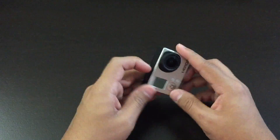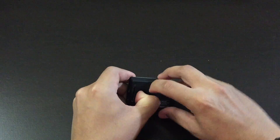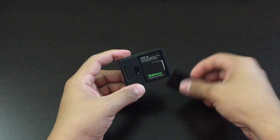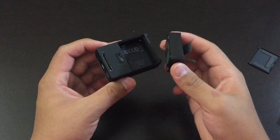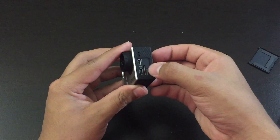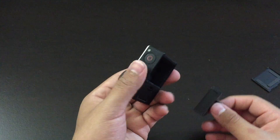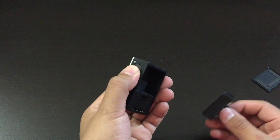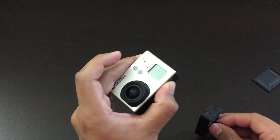The next thing you want to do is go on the back, remove the battery lid, take out the battery. After you remove the battery, then you want to remove the SD card that you have inside. From here you want to hold the capture button for five seconds, insert the battery, and then you want to hold on the power button at the same exact time.